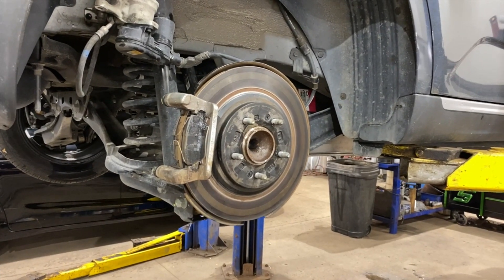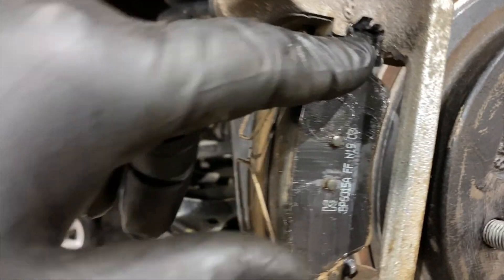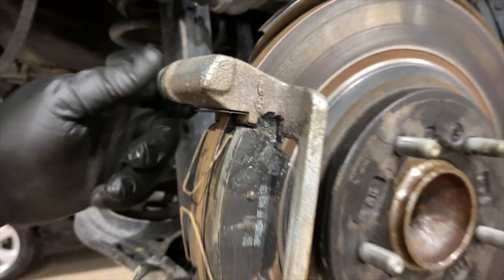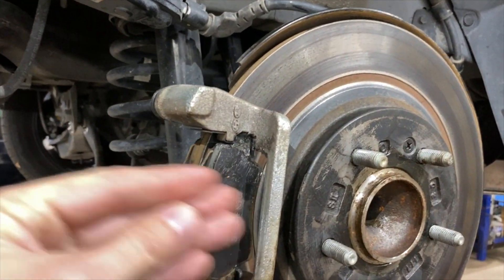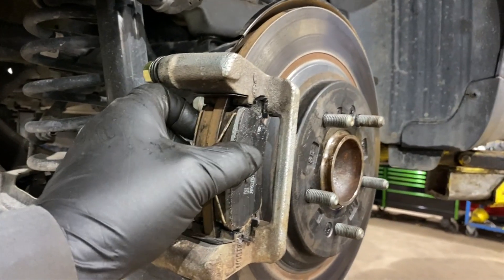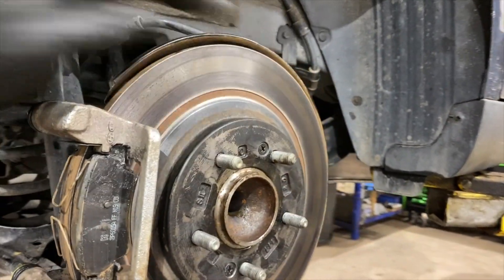Chris has now done the brake service on the rear wheel. Chris, tell me what I see. The first thing I notice is a lot of lubrication in there. That point has been cleaned up and well lubricated so the pads can freely move, as well as the pins. Just to be clear — these pads are moving in and out, so that's a sliding point. They have to slide freely, and we also get rid of any rust ridge and clean the hub face.